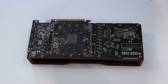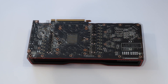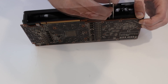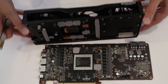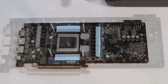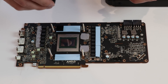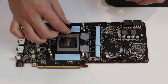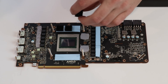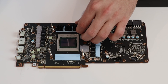You can't necessarily use the mounting kit entirely out of the box — you do need to pick up some screws. I used Kryonaut Thermal Grizzly thermal paste, which is supposed to be one of the best on the market. I also got some Arctic thermal pads to put over the memory, and then I put some small metal heatsinks on there that also touch the Kraken G12 to hold it down and potentially offer a little better cooling performance. That should be enough cooling for both the VRMs and the memory. Getting a little extra airflow on these cards when you do custom water cooling is always a good idea.